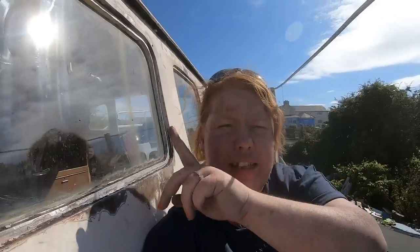What I'm actually going to do, which I don't normally do, is paint some aqua steel on that overnight. What the aqua steel does is go black in places where there's rust, so it'll actually show me if I've missed anything, and then I can go over that tomorrow. So that's just under that lip. I need to spend a bit more time with a Dremel and just go around these windows. Back tomorrow, carrying on, paint tomorrow.